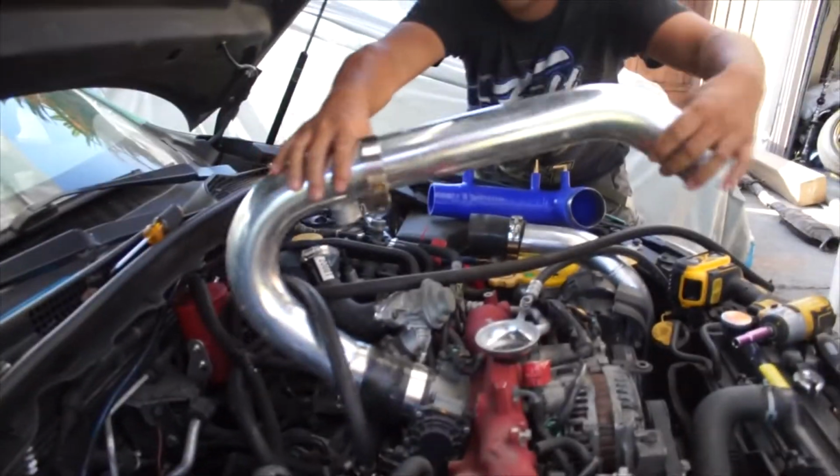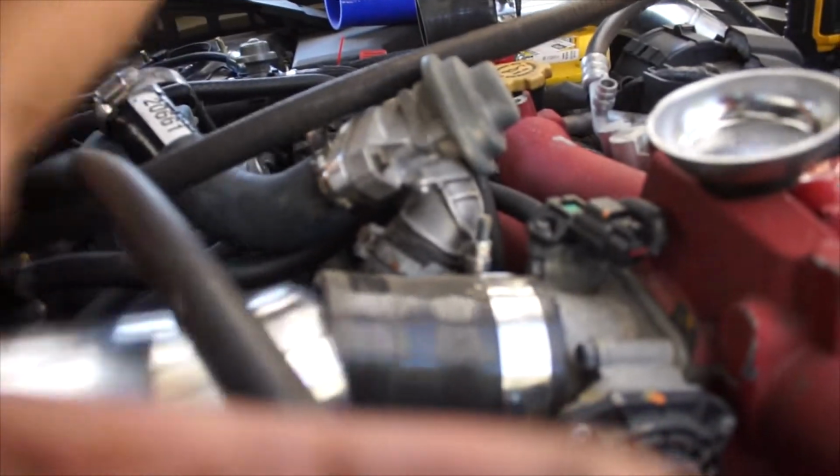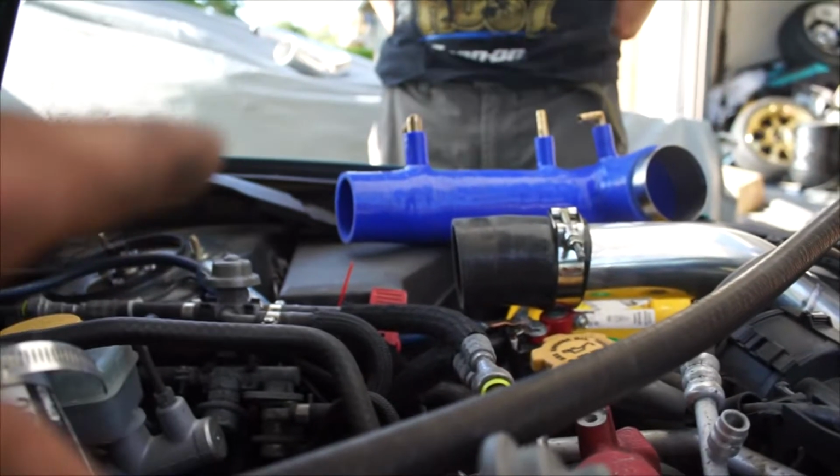Alright guys, little update. You already saw we took this off, but Daryl's now taking off the other boost pipe, just so we can get this blow-off valve hose off, the one right here. Oh shit, sorry. Hey, you dropped the clamp. We need access to this hose, to the blow-off valve, so we can take it off. Focus. Grab that clamp. Hold on. That hose clamp right there is connected to the turbo inlet, and that one is connected to that little hose outlet right there. So we're gonna replace that with the new clamp. Once this comes off, it's easily accessible to pull the whole inlet out.